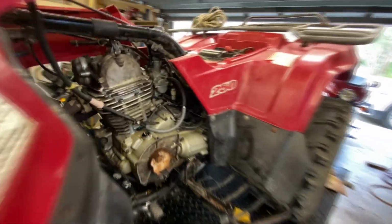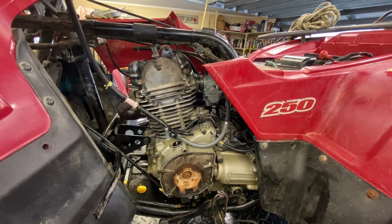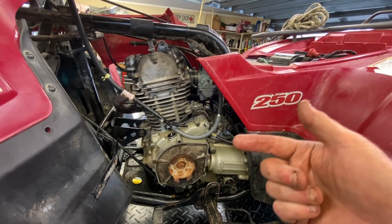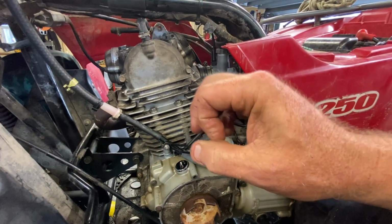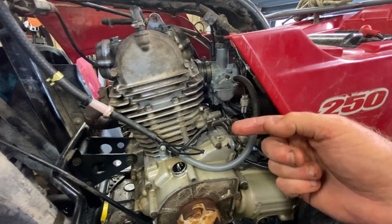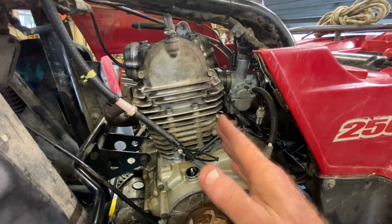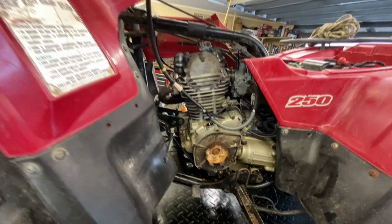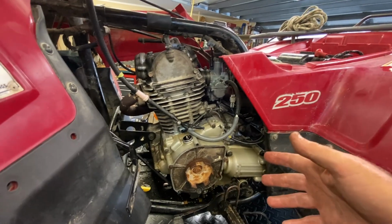So yeah, it's not the right repair, but I remember that trick from the old Vulcan 1500 and 1600, because they had a problem with that same issue with the cam chain tensioners pretty soon, early I should say, in the life of the motor, extending almost all the way out, and so you didn't have much more tension on. There's one of these, it looks like a ball bearing that fits inside of a taper that locks that thing so it can't come backwards. So once it goes out, it stays out until it's removed. So it's definitely working now, but I bet you still it's two-thirds or more out of, down that slot rather. So that's how we dealt with that. So we have good cam chain tension. But again, it's not the correct fix, but we're not going for that on this job.